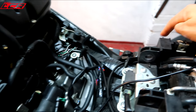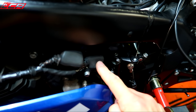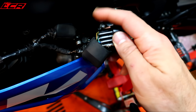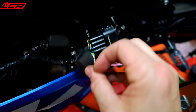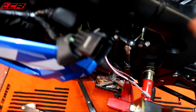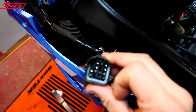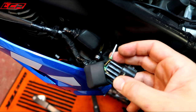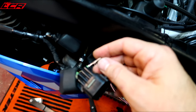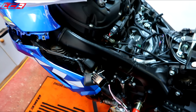We've connected it into the brake system. Now we have to connect it into this connector here, which is for the speedo and the rev connections. We've backed out the brown, the black, and the pink and white wires — that's the speed and that's the tacho. This is actually the worst part of doing this — it's quite fiddly to back out these connectors, and you're very aware that you don't want to bend or break anything. It takes a little while to get a feel for catching the little latches to pull them out. That's the hardest thing about doing this so far. But they're out now.